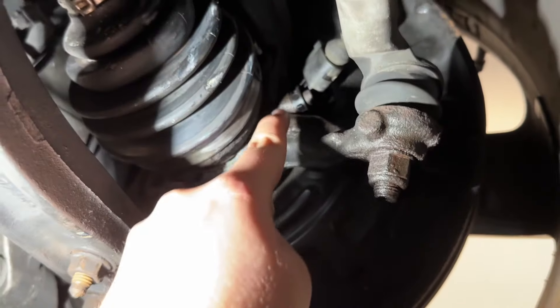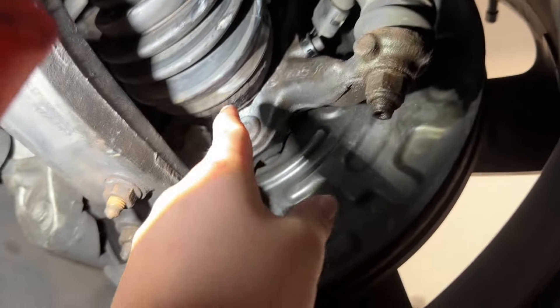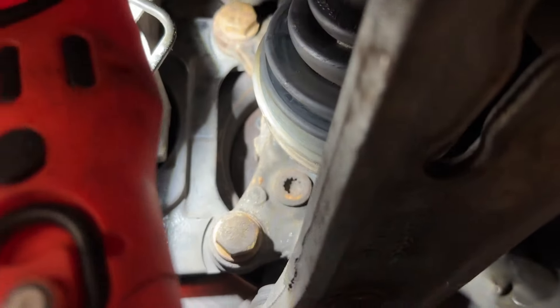So that's the speed sensor — that's the ABS sensor — and we're saying that's in the bearing here. This is called the hub unit on this side. And the wheel bearing — if you come around here, that in there is the outer casing of the wheel bearing, and then there's the flange which pushes in.